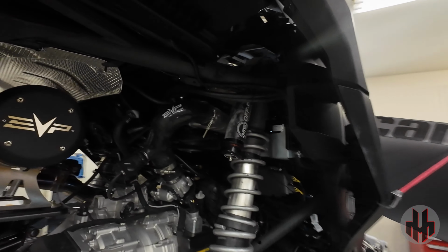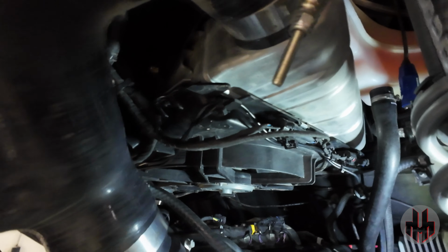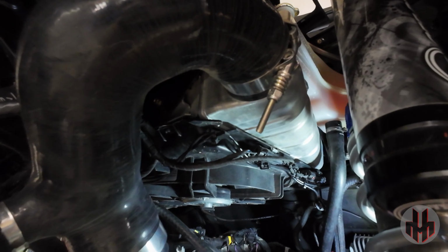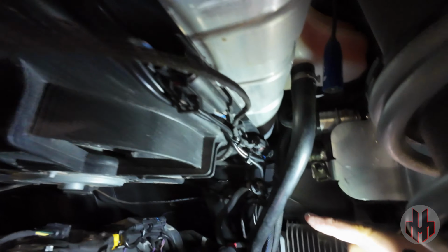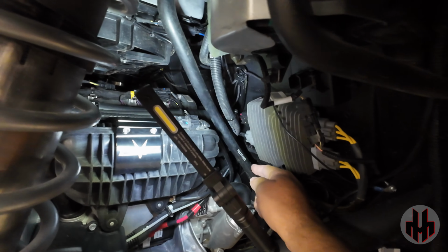So, going to the other side. Like I said, I came across the shroud area and tied in here. Now, I left some slack in the wires. That way, if you're undoing the shroud from above or whatever, you can move it a little bit and not tear any wires. Then I ran to the front here, and I came to this wire loom. Let me show you from this side. This wire loom goes down the front of the motor and pretty much stays away from hot stuff.